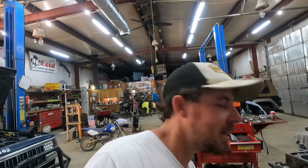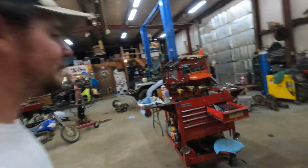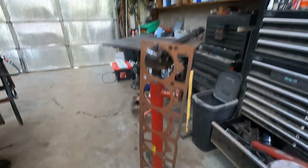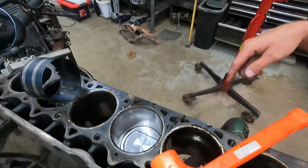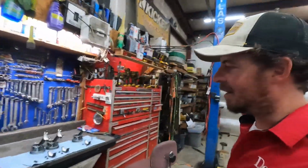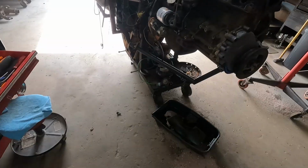Kind of left out that I was teaching that part, but got all the pistons in, so let's finish it up. And you need a head gasket if nobody knew that one. Just something I do after I do one piston at a time, and go ahead and see if it'll spin freely, because if you get the caps mixed up, and usually if they're wrong, when you bolt them together, the motor will get too hard to spin over, so catch it as early as you can.